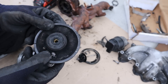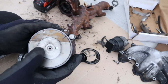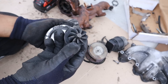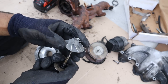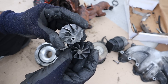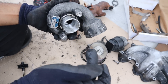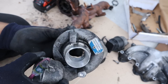Taking a look at the turbocharger housing, it has quite a bit of weight to it as a cast piece. It's got bearings pressed in, and your inlet and outlet for the oil to lubricate those bearings for the shaft. This is the exhaust impeller connected to the shaft, and that's what bolts the intake impeller on. You can see they have a slightly different design — on the intake compared to the exhaust — because instead of the exhaust pattern, the intake side actually sucks air in from this direction, and the design of this intake portion is critical to its efficiency.